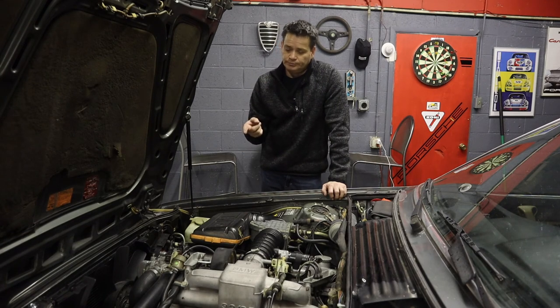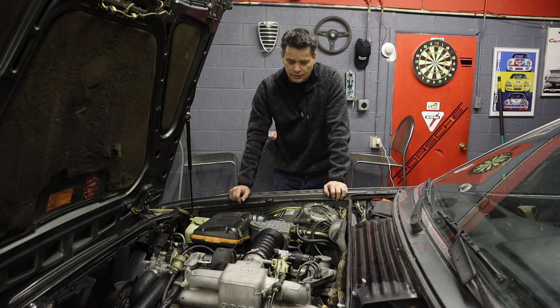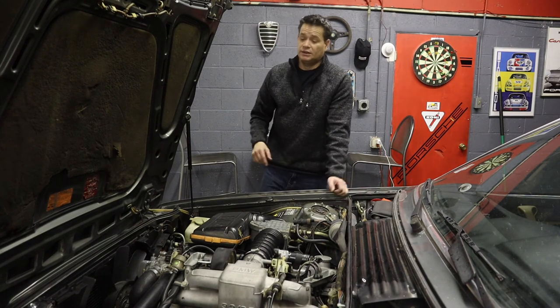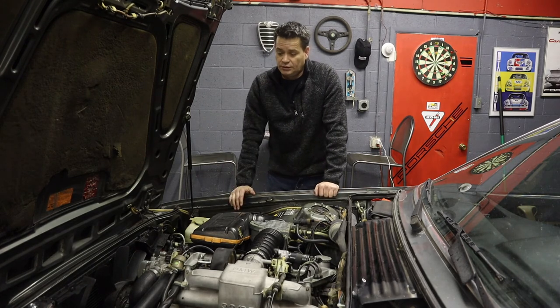I broke the one in the car, and then I had a parts car, and I tried to pull off the thermostat housing from that car, and I broke another one of the long bolts. And maybe some heat against the aluminum to get it to break the seal with the corrosion. It's a pain. Luckily, one good thing is that the whole housing comes off the engine if you do end up breaking something on the thermostat.